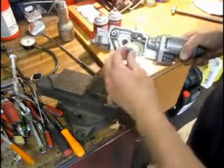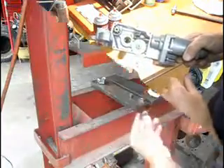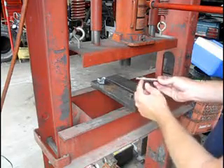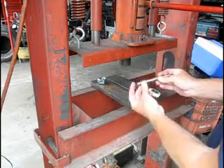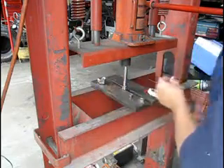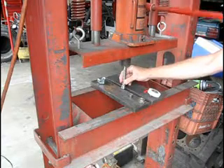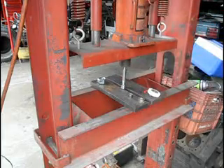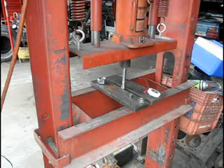The first one is very simple — just put it right back on its shaft, line the teeth up with the worm gear, and that's all you need. For the second one, we have to reassemble the whole threaded rod. First, it goes on the first flange and we want to press that on — we don't want to just hand-place it. Get your press set up and gently bring your hydraulic press down so that the base goes back onto the shaft 100%. You'll feel the pressure on your hydraulic press increase — that's how you know you can stop.